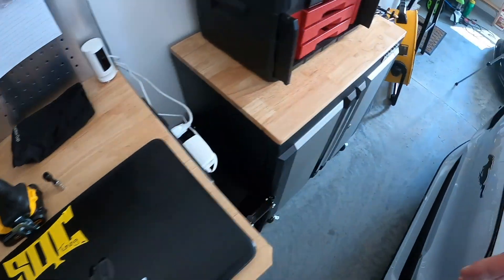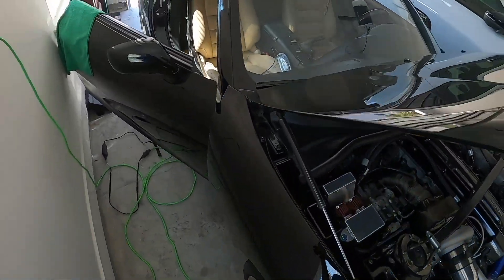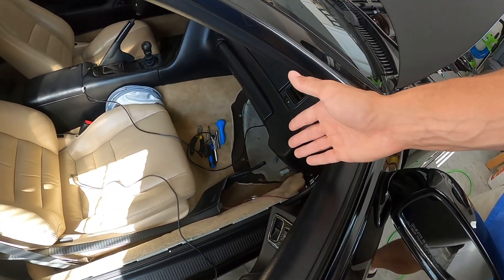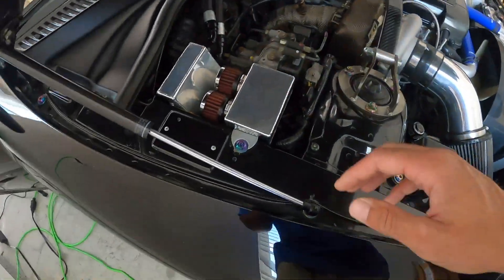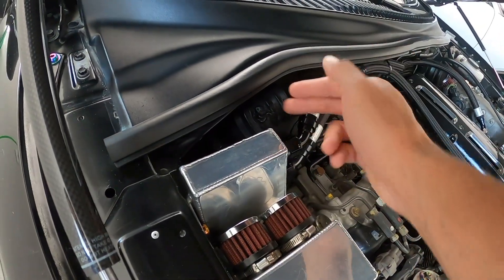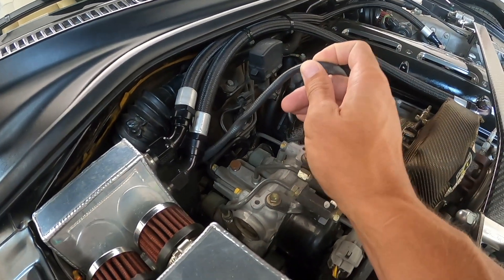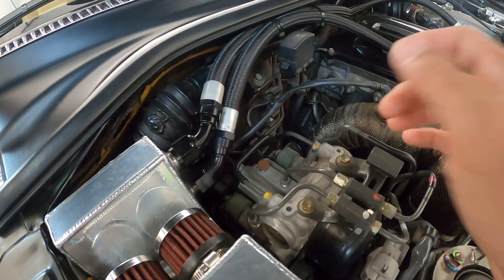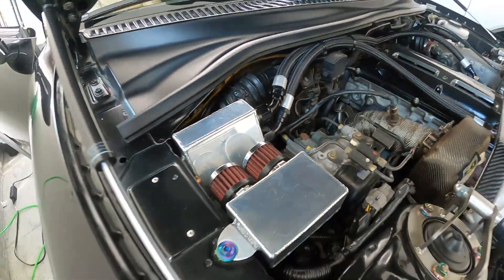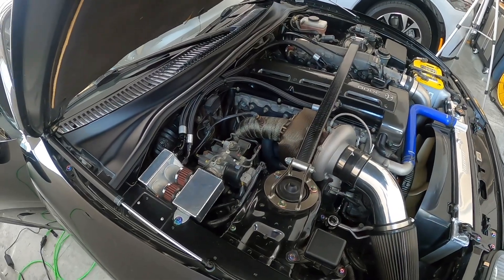As far as removing things from the car, I already have the ECU readily accessible because I've been doing some idle adjusting over the past couple of days and weeks, so everything's already taken apart down here. I'll remove my catch can and set it off to the side so I can get back to the harness that runs into the firewall. I already have the current 4.9 running through underneath here, so I'm just going to remove it, set up the new one in the same position, run the wire in, connect it to the ECU, and verify everything senses correctly.